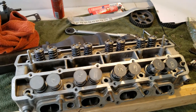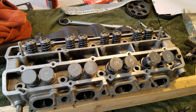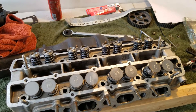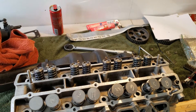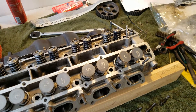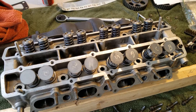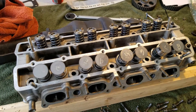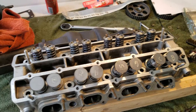It's just a matter of how many times I'm going to have to remove the cam towers and try different shims before I get them right, and whether any of the valves are worn or the shims compressed since they were last done. If I have to order new shims, that's another three-day delay at the least, so anyway, here we go.